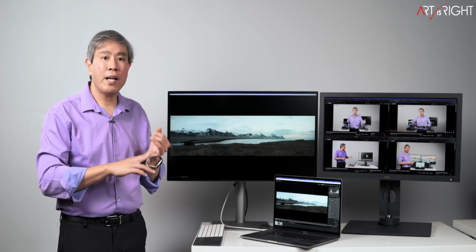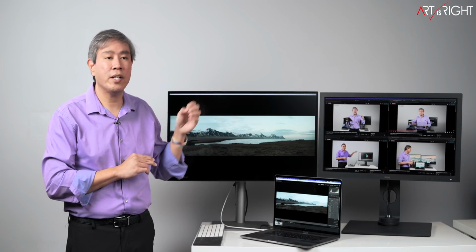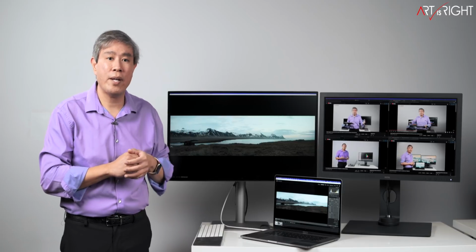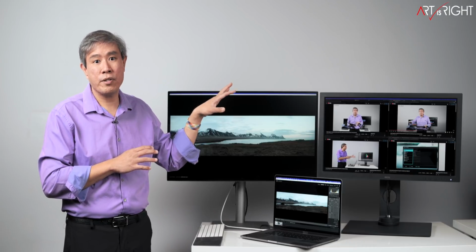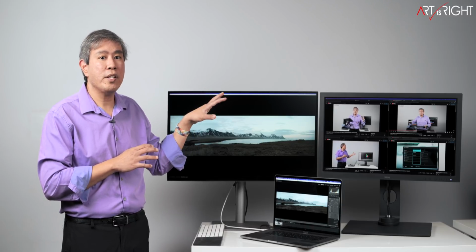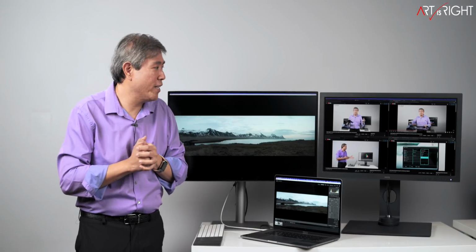I have Lightroom Classic, Capture One, and Final Cut Pro running along with 2 browsers, as we have done in all the other tests. So Chrome and Safari are actively playing videos, and it also has tabs in the background. In addition, both of these displays are 4K, but they're running at scaled resolution at 3360 by 1890, so they are pushing around 25.4 megapixels, 60 times per second to each of these displays.